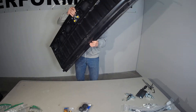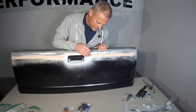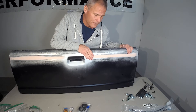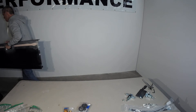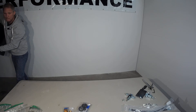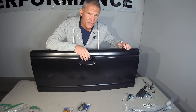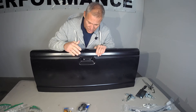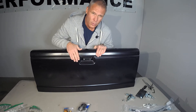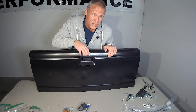The only real difference between the tailgates is that on the Charger, you're going to fill this groove — I have this filled here. This Bondo shows you that little V-groove on the standard Ranger tailgate. You fill that with Bondo on the Charger because you want a nice, smooth look. On the Audi and VW, you keep the groove because that detail line matches up with the tailgates on both cars. On the Audi, you do not use the center actuator — instead, a fiberglass cover covers the entire rear to match the shape, so the handle goes on the inside.